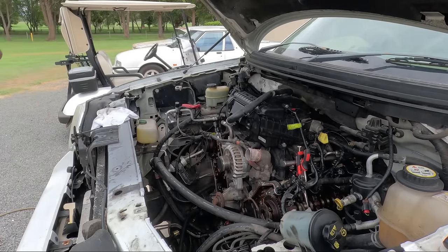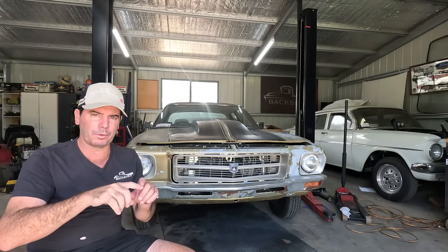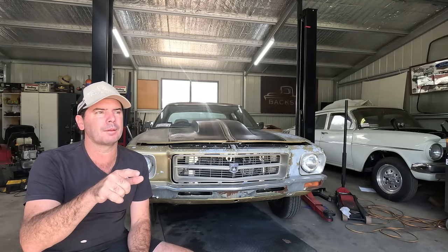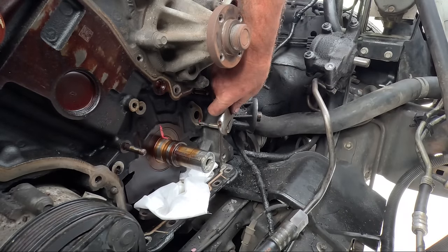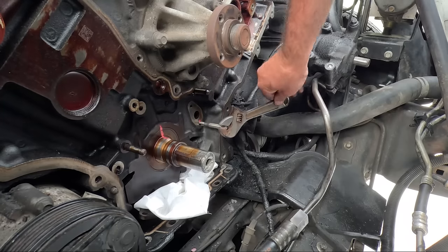We're getting there. It's kind of hard to get down into the bottom of that engine bay, but with the chains off, the oil pump can come out and I could get to the head of that broken bolt, drill it out and then just tap a new thread. Slow process, but in we go.